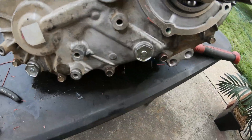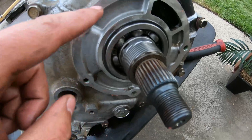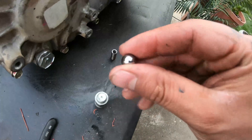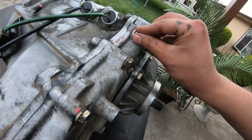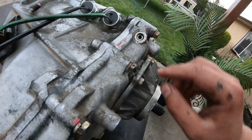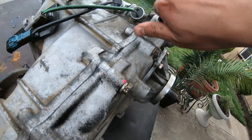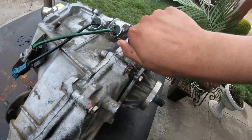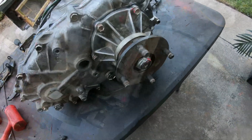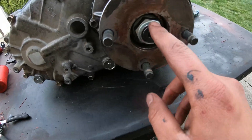Start with the reassembly. Got both halves sealed back up and cleaned up the RTV. Don't forget to put your snap ring back in place, then reseal this. Remember to put your little detent ball back in and then your spring with the cap — same thing on the other side. Then replace your drive shaft yoke and re-stake it.